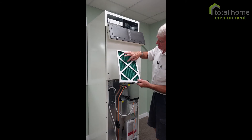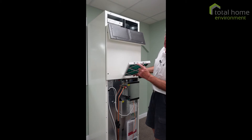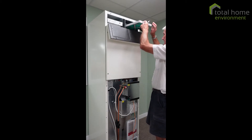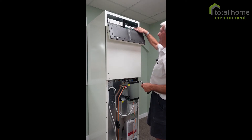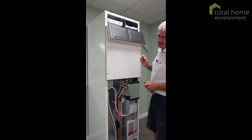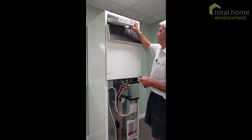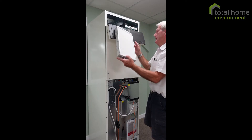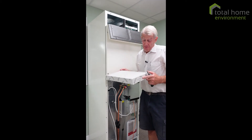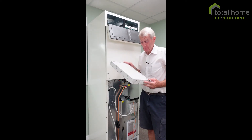You'll notice on the back there's a wire mesh. That should always be downwards, and if you follow the arrow you'll see that's the way it should go. It simply slides in. Clearly you could vacuum it off if it's dusty. If you have serious breathing issues, this is the important filter — this is an F7. It will clean out about 80% of material or particulate down to about 0.4 microns.